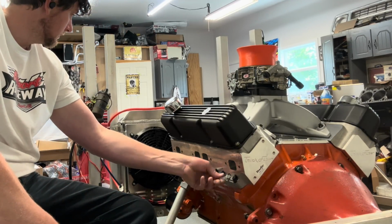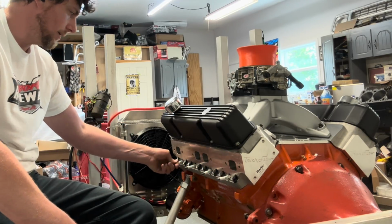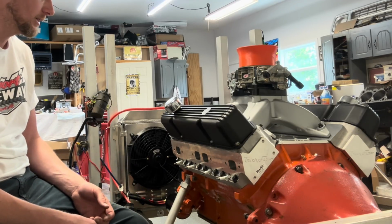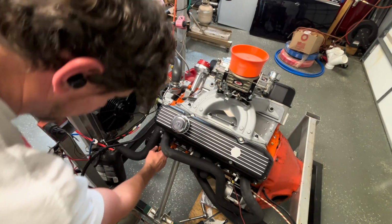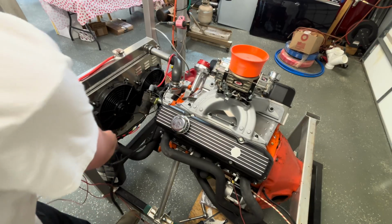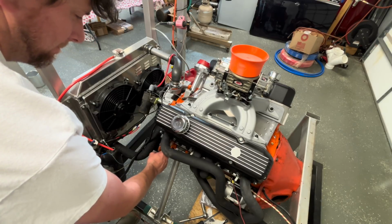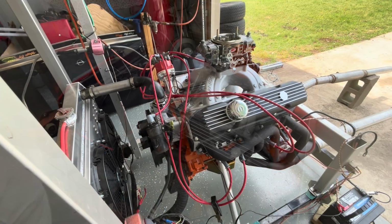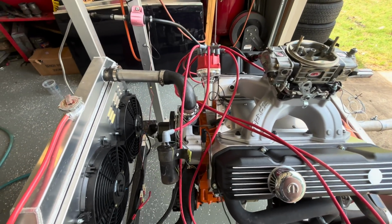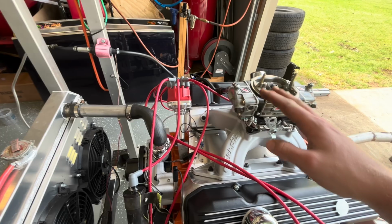And what else? I got to be sure my batteries are good and charged. I'm not running an alternator on my run stand because it's only going to run 10 or 20 minutes. I'm checking for leaks, being sure everything sounds good. And our top dead center real quick. Hopefully this thing won't light me up like in previous days. We'll unplug the ignition, all that jazz. There it is. So it's about time for the fun part. I got us all wired up and ready. I did check for spark at the cap, so I know when I turn it over, it sparks there.